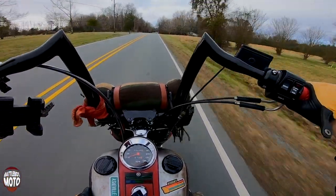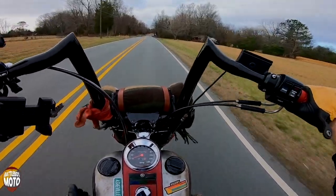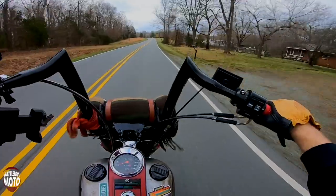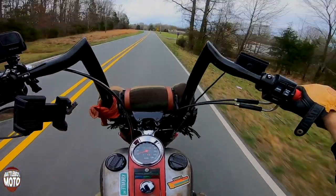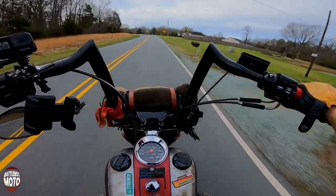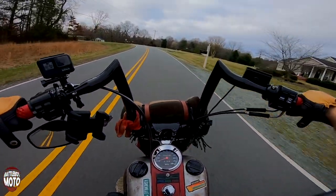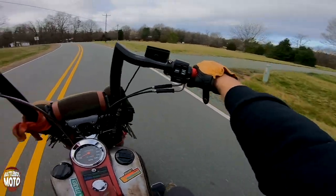This EVO engine loves cold air — it feels like it has an extra gear. It's a five-speed transmission in this one; it's a '94. But when I pulled it out to warm it up this morning and cut the choke off, it wasn't idling properly. It just sounded kind of funky, idling high.